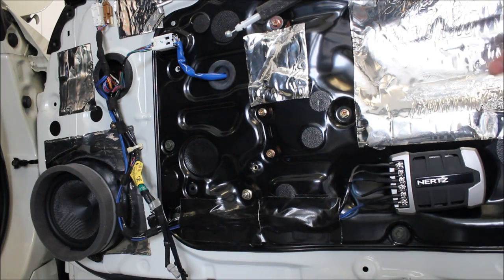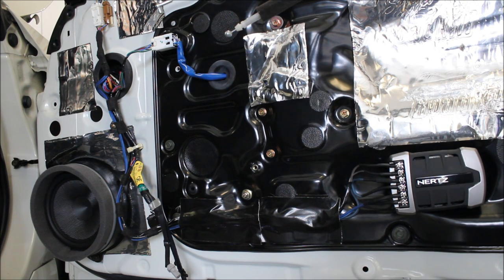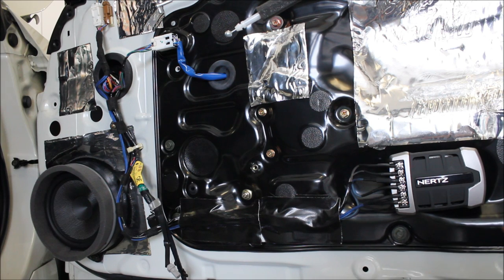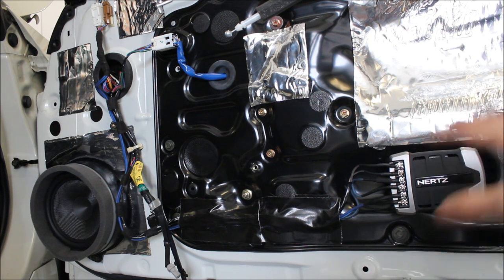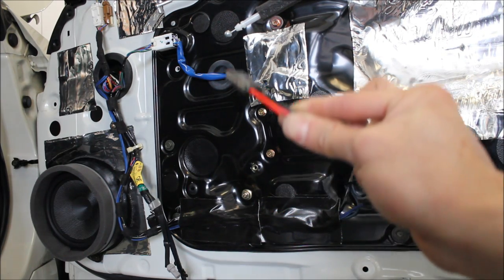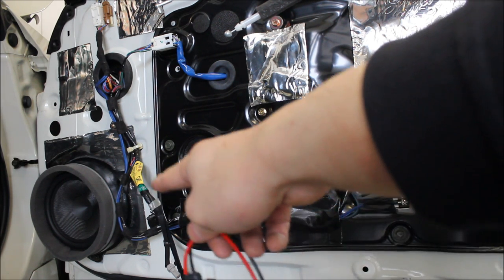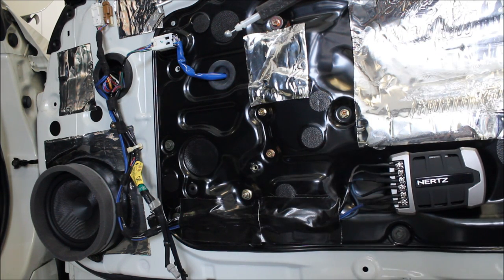We will have to remove the styrofoam from the inner door skin, but you can access every single fastener. We did use the factory connectors on the tweeter so you can take that apart. In this particular install, I didn't want too many connectors, so if you did have to remove the woofer you would have to cut the wires. You could take it one step further and add quick-disconnect connectors — I've done this in other installs if you want to make it very serviceable. I've already gone ahead and tested the speakers and it sounds good. I left the crossover at zero — not minus two or plus two on the decibels — and liked it at zero. Now we're ready to put this door skin back on.